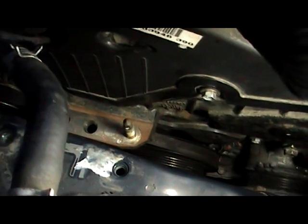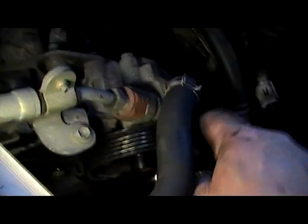Now we've put our cover back on — that's all tightened up. Our next step is just to tighten up the pump here, stick our engine back into position, put on our engine mounting, and put on our power steering belt. That's our next operation.